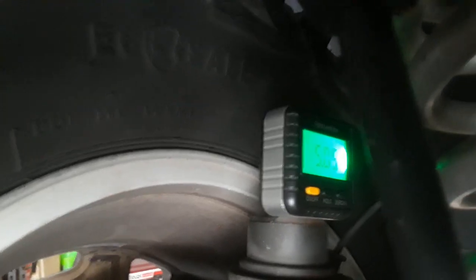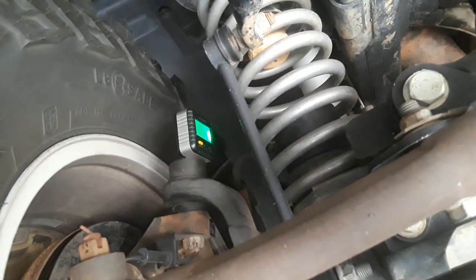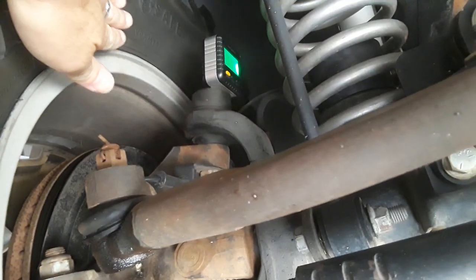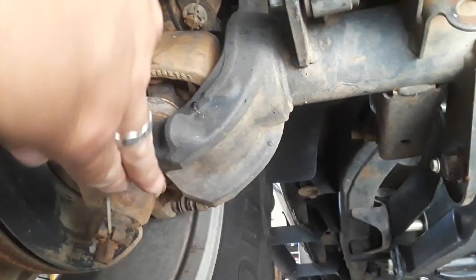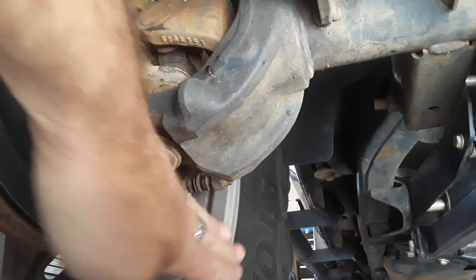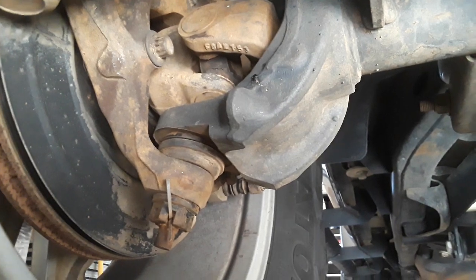You'll have to believe me that's five degrees — you can see where I'm going right off the top of the ball joint. You have to make sure this is parallel to the tire because as you turn it you're going to see different degrees. You can also go right here on the bottom of the C part — you can see these two flat surfaces. Run a straight edge across and put your angle finder under it and you can do it the same way.